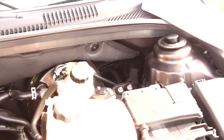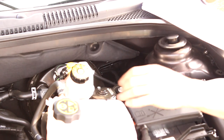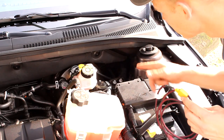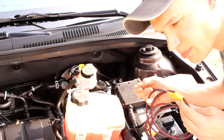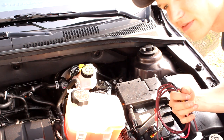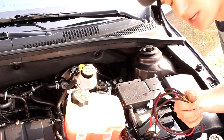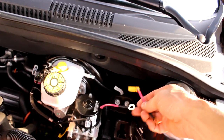This is really hard to show because it's dark and it's way in the back, but we basically moved the coolant reservoir to get to the factory grommet. We've cut a little hole in the grommet — there was a little nipple underneath the factory wiring harness and I was able to cut that so I can get both wires in.